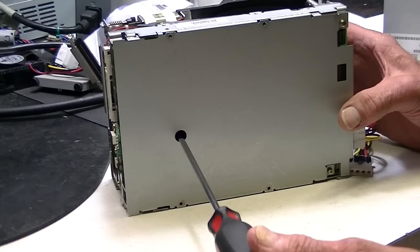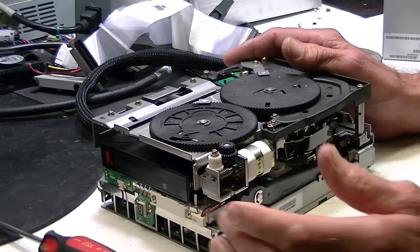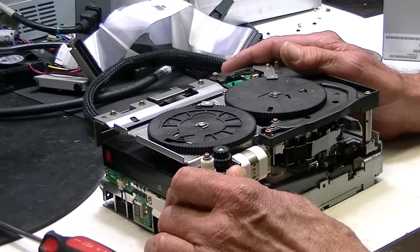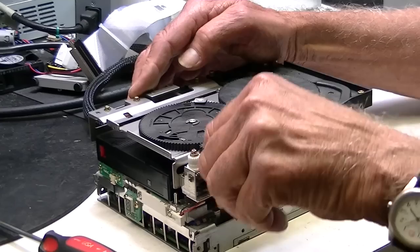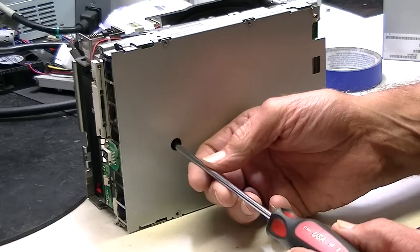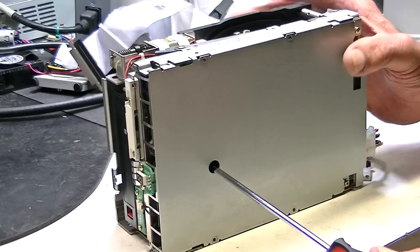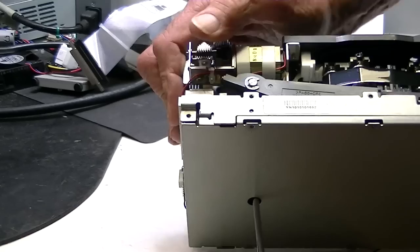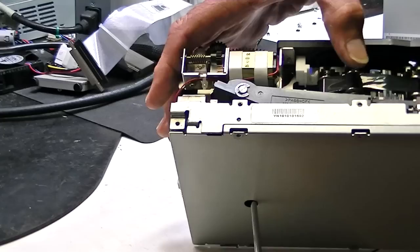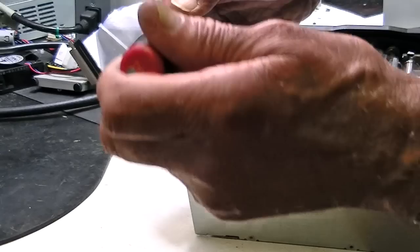Now I've got tension. What I need to do is stop here and rotate the tape drive this way. As we demonstrated with the load and unload, you saw these gears starting to turn — without power, you've got to manually turn these gears. On this particular model, it appears I need to rotate this gear this way. I want to keep it on the side here so you can see that I need to take the tension up in this tape — see how loose it is? So we reinsert the Torx here and keep the tension across. As I spin this, I'm putting tension on it, and you might see that the tape is moving.